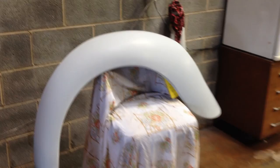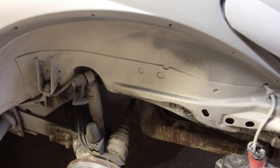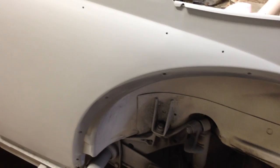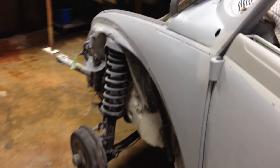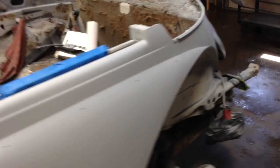I'm ready to paint the fenders. I'm going to paint this thing a pearl white, which is a three-stage paint, and I need to have these bug fenders off. From my little bit of experience — or my lack of experience — the curvature of these fenders right in here will not allow my paint to go on consistent, especially the tricoat, the middle part, which is the white pearl. The pearl has to go on consistent, and if I have too much in one spot, it's very, very noticeable.